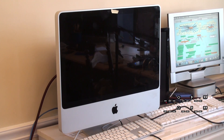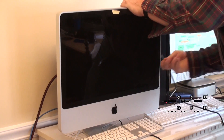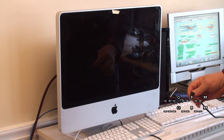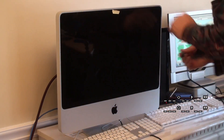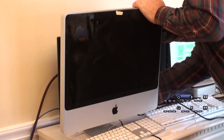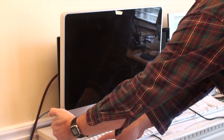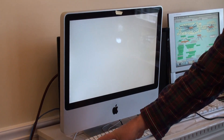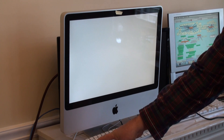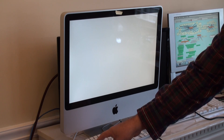We're at the point where it's time to try and back it up. We're going to put it into target disk mode and connect it to another Mac. We have here a Firewire 800 being connected to another Mac. We'll plug this in and then boot this up in target disk mode by holding down the T button and turning it on. It will come right up into target disk mode, where the Macintosh becomes a hard drive and we can get to it from another machine.